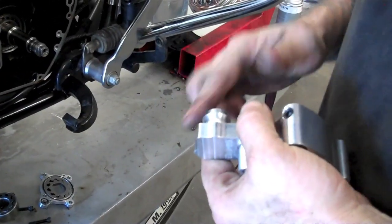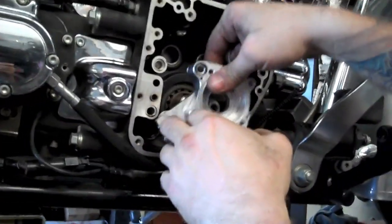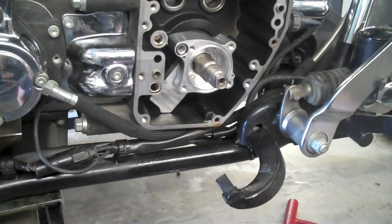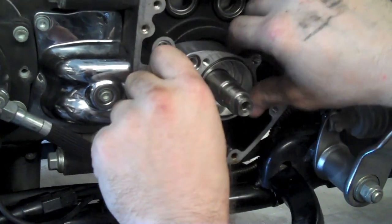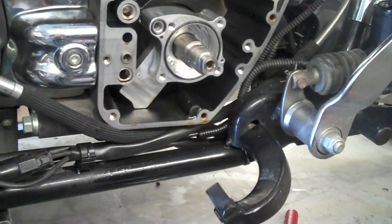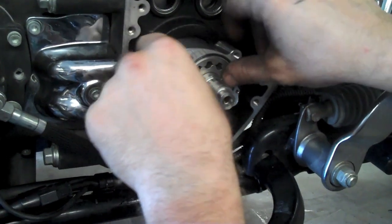Always take a little bit of the leftover oil and just coat that so that it slides on. We're going to put that into the case rather than have it stay on the pump — put it right in the case and have it set ready. A little bit of oil again to lubricate it, let it slide in. There's the pump installed. The o-rings: this one goes here — this is the return side of it. It's going to be the fatter gears — the larger gears handle the return because the feed is pretty much gravity, almost.